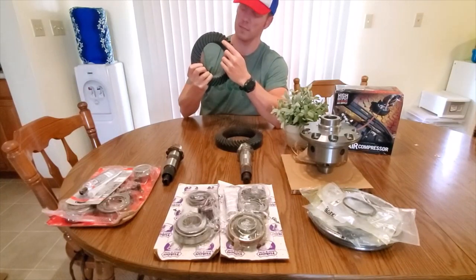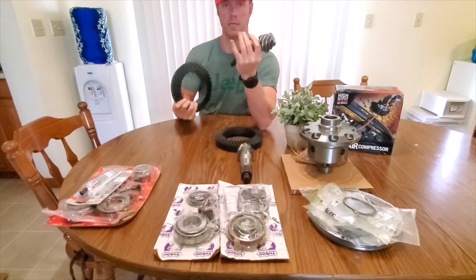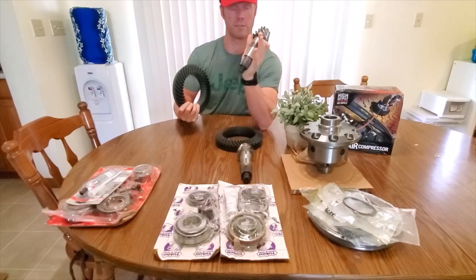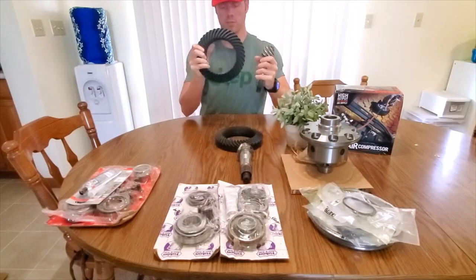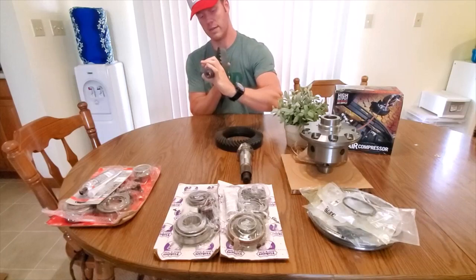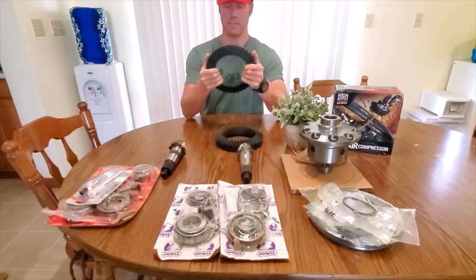On this gear, the curve of the actual gear teeth are marked to a greater degree, and they've given you more teeth contact on the pinion. These pinions are monsters — I wear like a size 12 glove, I'm 6'2", and holding this thing it still feels massive. They increased the size of the bearings at the pinion head and how they contact, with a greater degree of arc. So when they were machined, the cut has to be very precise. These are incredibly heavy duty and really well made.